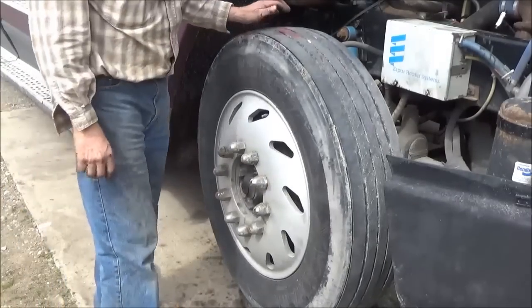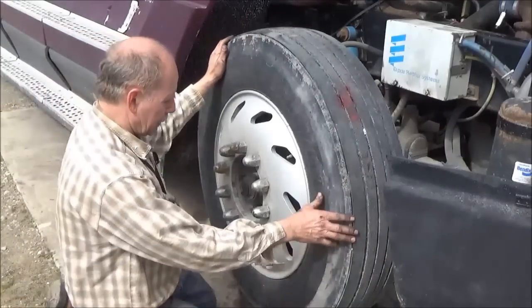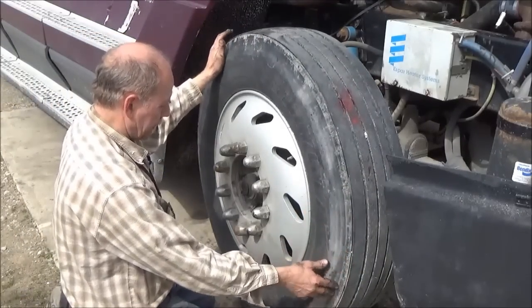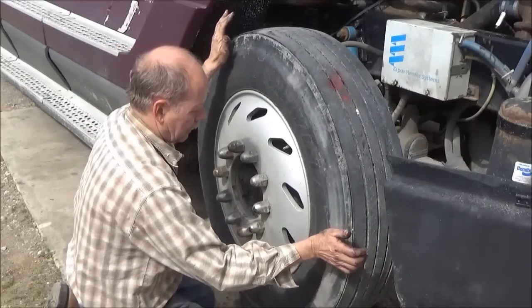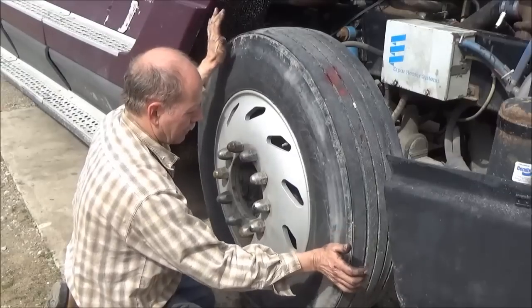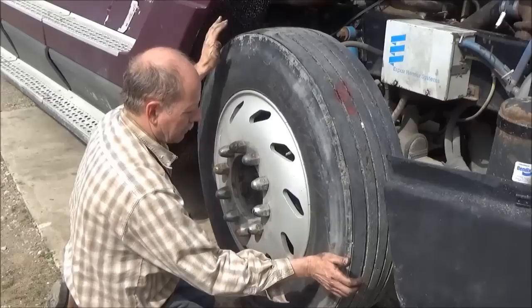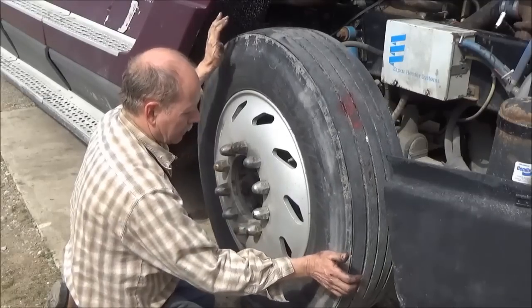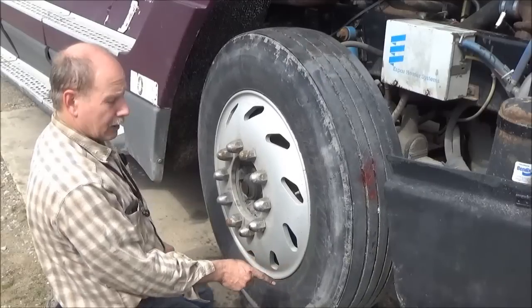Brakes are freed up, and it's not a perfect balance, but this gives you a good idea if you're in trouble or not. Just kind of give it a little push this way. See how long it takes it to stop, and the same thing the other way. If it keeps going like it's doing now, well then it's got a heavy side over there — look at it, it's taking off now.